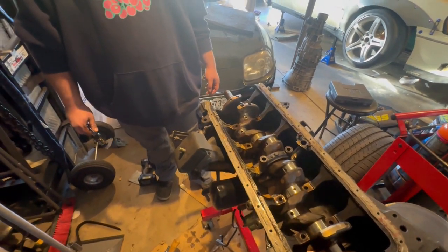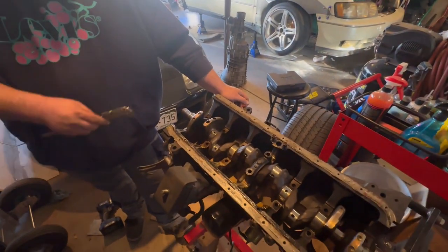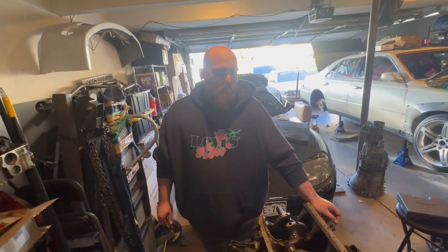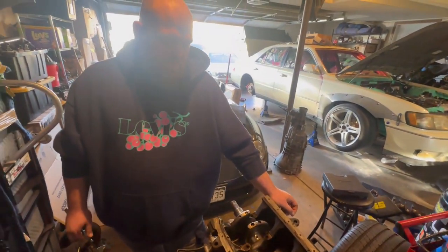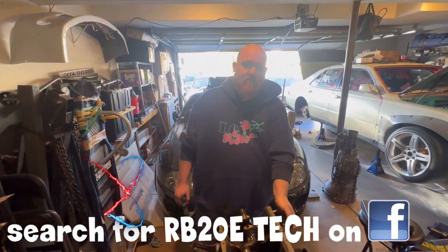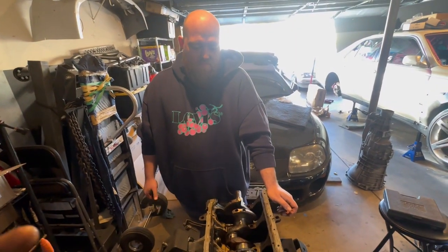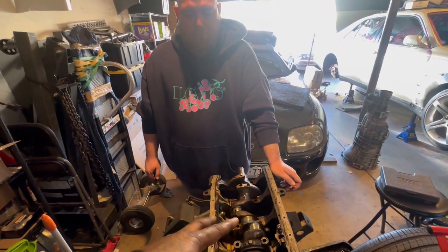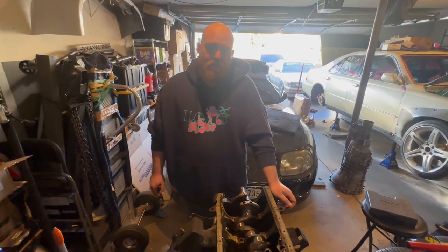This is our solution because getting custom pistons is very expensive and you have to do a group buy. So I think that's a pretty good and cheap solution. I've got another crank and another block, so might do both at the same time and get it tapped for turbo and stuff like that. This was his idea, but we're gonna order up the pistons and rods to make sure that it fits — so it's gonna be like a 2.2. If the walls are thick enough to accept the 86.5 pistons, we should be somewhere between 2.2 and 2.3.